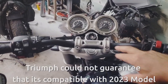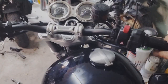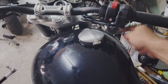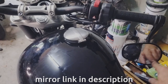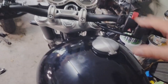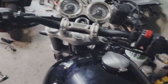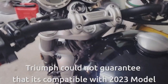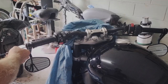The first thing I'm going to do is take off the existing handlebars, unscrew those four Allen bolts, and just see if the new handlebars will actually fit — whether they'll jam against the fuel tank or the mirrors will hit the fuel tank. I'm going to use aftermarket round mirrors so that should be okay. I know the whole kit will lower and move the handlebars forward, so before I start taking stuff apart let's just check that it fits. It'll definitely fit, so I'm going to go through with it — I'll just start removing everything.